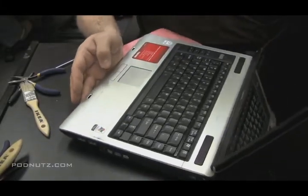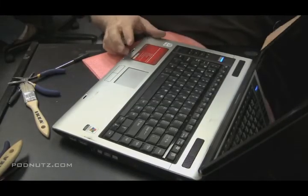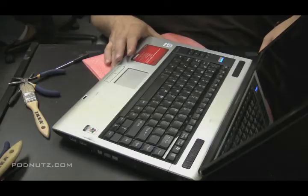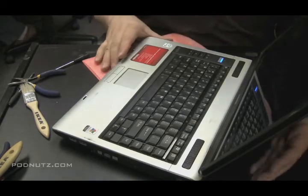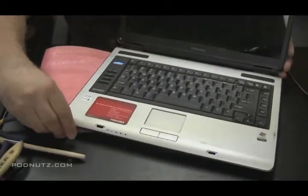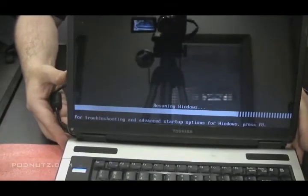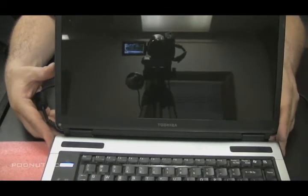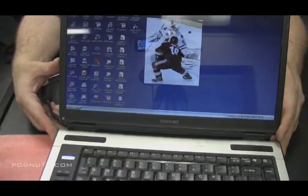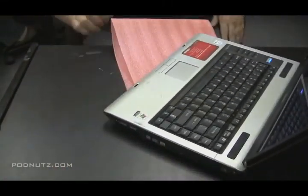that repair we did now makes it so you could jiggle that adapter in the power jack. You see my hand there, it's jiggling it just to test it, and the computer's not going off. You could jiggle it in there, and you're not going to lose any connection. So we know it's pretty solid in there. And since we used that flexible wire, it's going to last forever. So that's how you do a power jack repair on a Toshiba laptop.